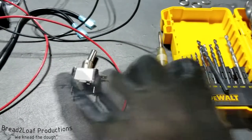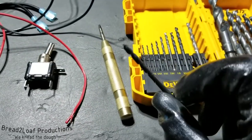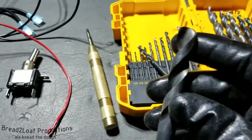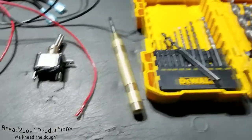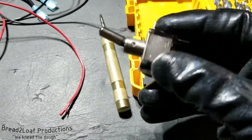Here are the materials: first locate it, then use a center punch to mark the hole, then drill with a small bit, and then final size — in this case a half inch drill bit, because we are going to the diameter of these threads, and that's what's going to stick to the hole. And we're back — I have drilled and mounted this switch. So now let's run the wires.